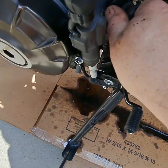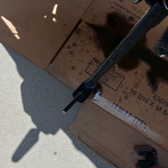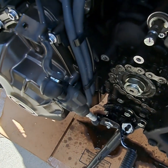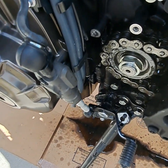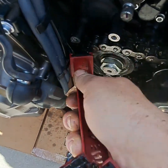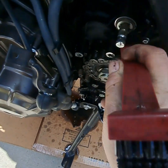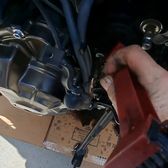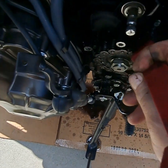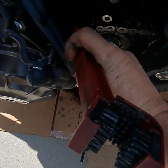It's a chain guide — it keeps your chain from slapping the vital parts of the casing of the motor, that's what that's for. Take that off, that little piece here, pull it out, and get in here and really clean this area. There's a lot — get your can of cleaner and spray, get down in here, right down in here, all behind that front drive sprocket. There's all kinds of gunk built up.